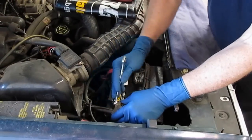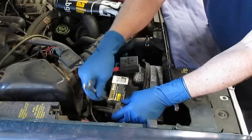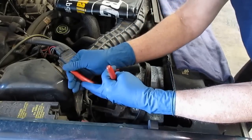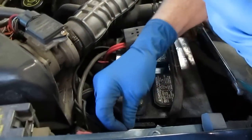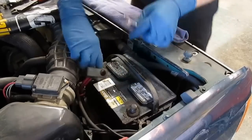Disconnecting the negative battery cable first — and putting it back on last — prevents voltage spikes and sparks. We'll take a little pair of pliers and open this terminal up, as this one got crimped in a bit too far by the last person to change the battery. Then we'll take the negative one off first, then go over to the positive one.